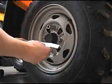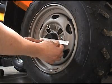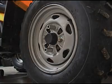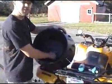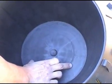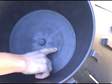If your wheelz were not pre-drilled, you'll need to measure between two opposite wheel studs to determine your ATV bolt pattern. To install wheelz for the first time, you're going to need to drill out this main plate for your particular ATV application. Now there's a millimeter scale that's printed on the part, you can see above my fingers, and it has the most common bolt patterns marked with a number and a drill bit.